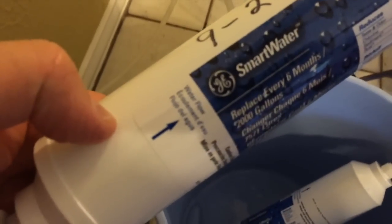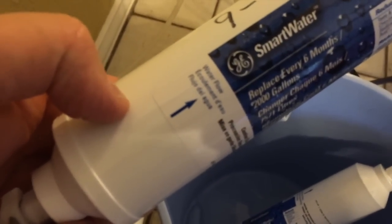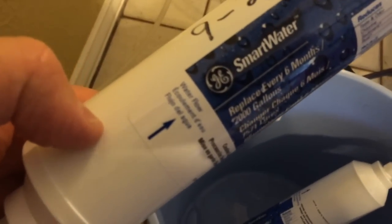You can see on mine I've got the old one disconnected and one end of the new one installed on the line already. You want to make sure you pay attention to the water flow direction on the cartridge itself — there'll be small arrows indicating which way the water flows. Don't put one of these filters on in reverse; you won't get as good results. My ends are quick-disconnect, they just snap on and snap off. Before I hook up the end going into the fridge, I'm going to flush this new cartridge out by running about a gallon or two of water through it, and you'll be able to see why in a second.